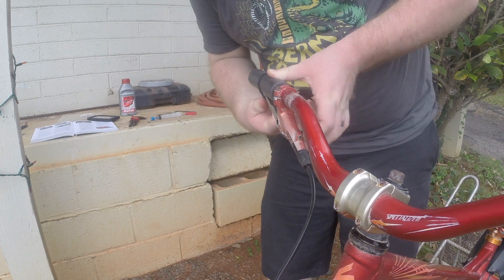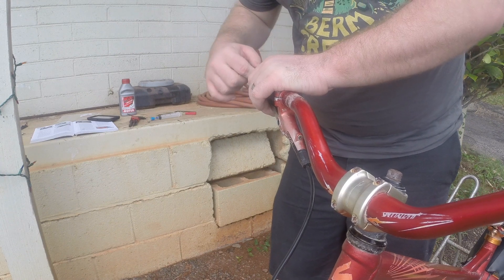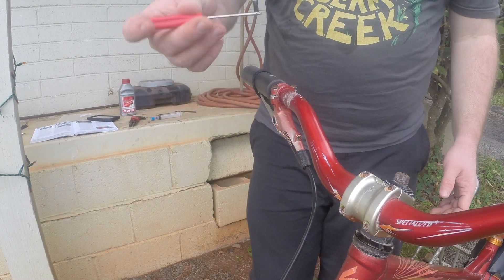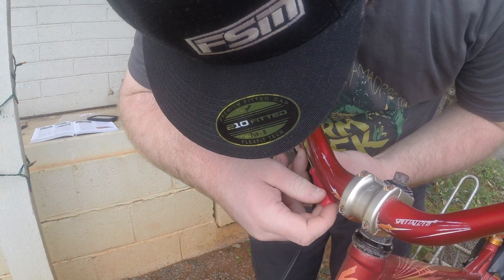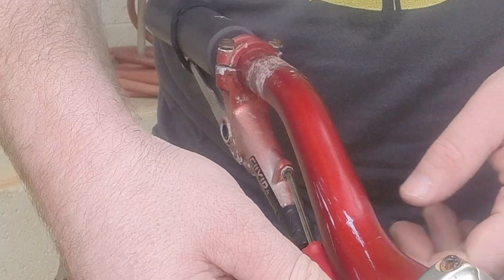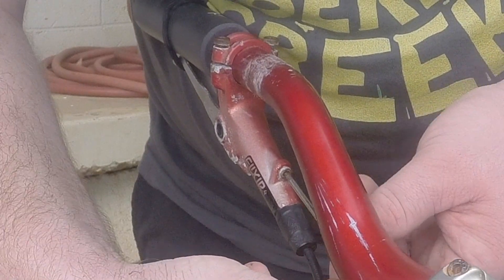You gotta make sure the lever is up against the bar. Once you've got that set, get your little Torx bit. Holding the lever against the bar actually closes the cylinder in the lever, so it makes it so everything is sealed off on that side. So what we're going to do is remove the lever bleeder screw again — don't lose it.